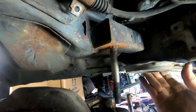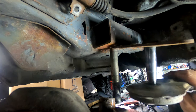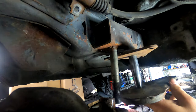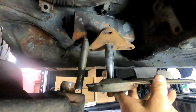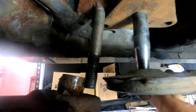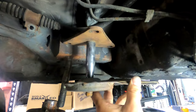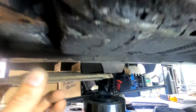Best case, I can just bolt it in and use it like the factory has it on the Eclipses. Let me fit this up and see how it fits. Because this is tapered, it's not going to slide all the way down, and the problem I see is this is already going to be very low off the factory floor pan. And it comes back to the rear pinion angle — on this chassis, this Mirage, this is just how it fits in here.